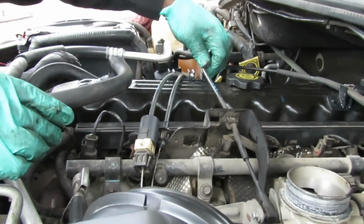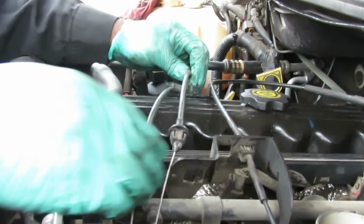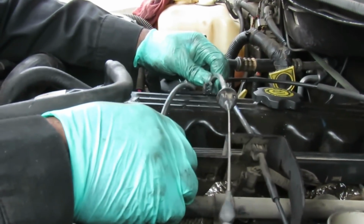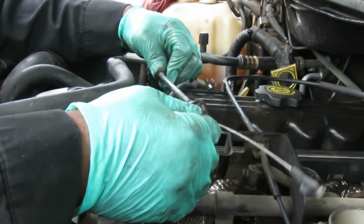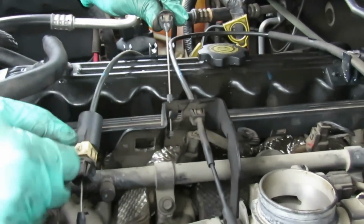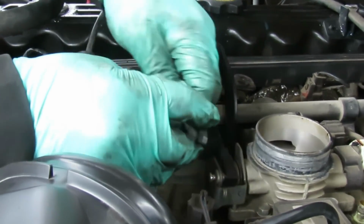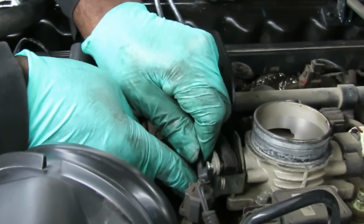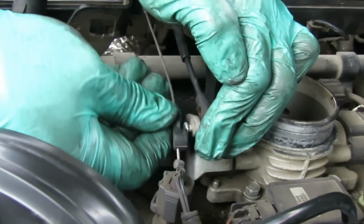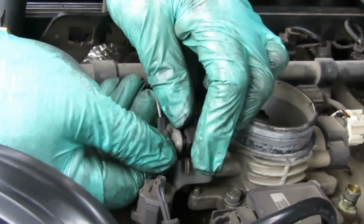All right, here we go, I hook. I don't want the people to forget. All right, then we hook it over here. Now number 2. I could have sworn I marked number 2. This is number 1. Mark them all 3 rather. Must have rubbed this against something. So we know number 2 goes here because number 3 got the big one. So let's put this down there, snap it into place. This one hooks on. You might have to open the throttle up a little bit. You're gonna hook it onto that, and then you gotta pull it till it can snap into place.